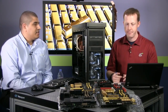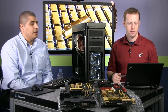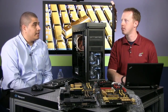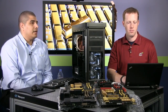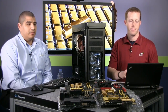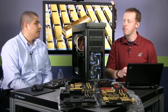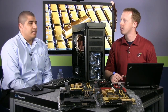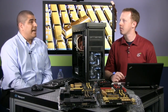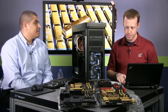At the end of the day, Z87 is a performance-oriented chipset. I think most of you who are going to be interested in building with it are going to be running some variant of a discrete graphics card, but where the iGPU is definitely going to provide some strong capabilities is in those everyday boxes. Maybe if you're going more value-oriented in terms of the type of build, or even if you're doing something media-centric, right? You've got full on-die decoding capabilities for a lot of high-definition video formats. So when you talk about building a quality, small form factor solution, it's still going to have a lot of legs in terms of what you can do with it, and it's going to have great power efficiency to boot, right? From a gaming proposition, there could be improvements, especially compared to where we know the maximum performance capability of what Haswell has to offer is in the mobile segment, right? But on the desktop side, like you said, it's a fairly moderate improvement.